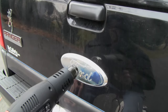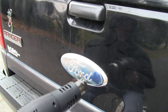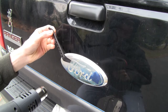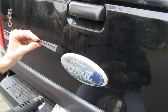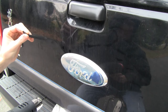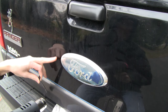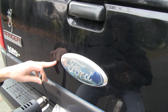We're going to start heating this up, trying to heat it evenly. We don't want to get one part too hot too fast — we want the whole thing to come up to about the same temperature at the same time. Once it gets hot, I've got this little plastic pry bar tool. I want to avoid using a screwdriver or anything metal because prying with that is going to mess up the paint, and I don't want to do that if I can avoid it.